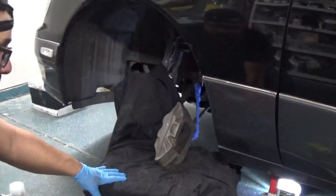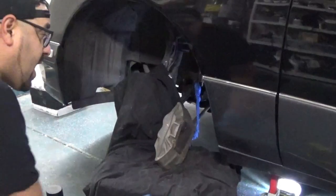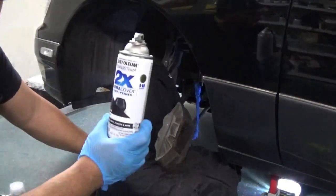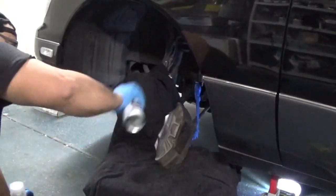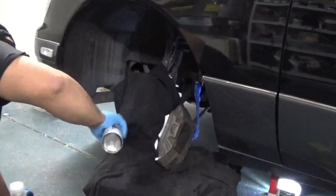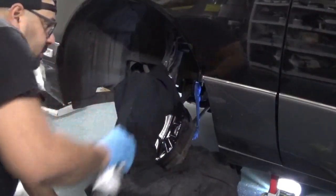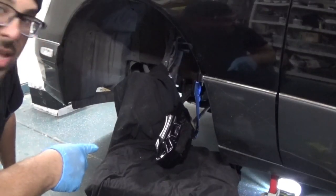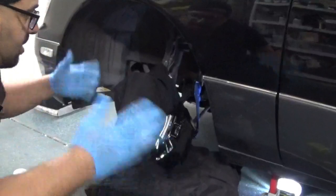I've got this masked off with some rags because I didn't feel like busting out the newspaper and tape. I taped the brake hose so I don't overspray that, and I stuffed a rag inside the calipers so that I don't spray the pistons. Now by popular demand I'm going to paint this black and I'm going to be using Rustoleum. I'm going to let this dry, then drop the Lexus sticker right here, and clear it with this crystal clear Rustoleum lacquer, then put the calipers back on.